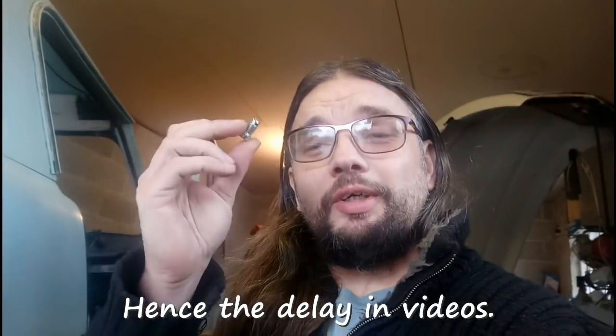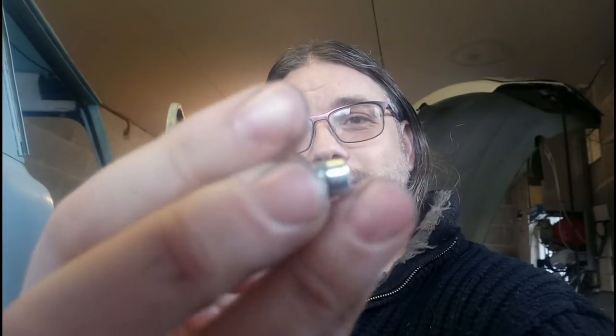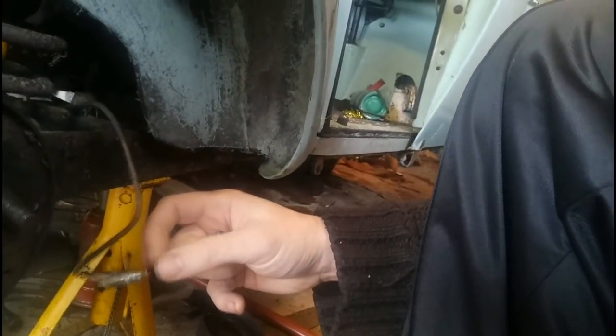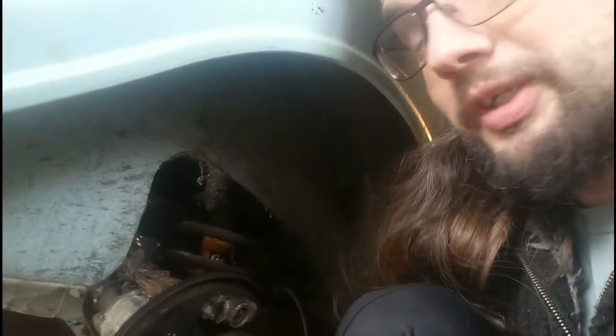I'm simply not up to doing very much work at the moment because I'm full of cold. But Passparts have sent some new brake pipe nuts. Just to replace this damaged one that I completely mangled up — the thread is utterly knackered. So I'm just going to see if I can screw this into the wheel cylinder. Let's find the right hole this time, because that was the problem before — I put it in the wrong hole. Don't put it in the wrong hole, it causes upset.